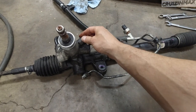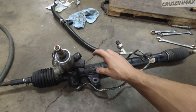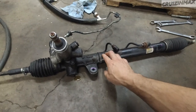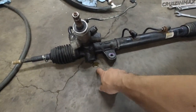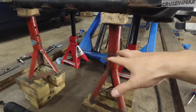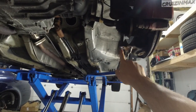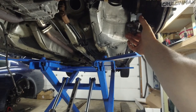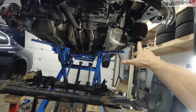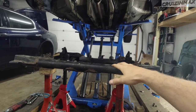You're going to have power steering fluid coming down — just catch it. What I did was I undid these lines yesterday evening and let it drain overnight. Once these two are out, you're done — the rack is free of any lines. It's still leaking. Once these are out, get your jack stands ready, and undo these — there's a bolt and two nuts on each side holding the lower ball joints. Once the ball joint brackets are loose, you're ready to bring this whole frame down.